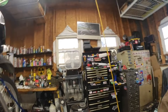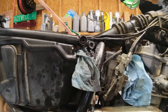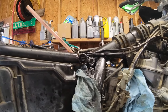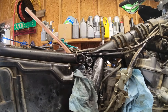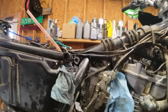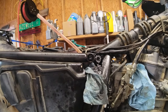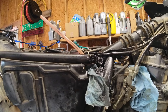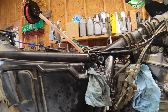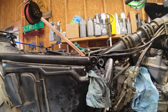Finally drilled through completely — I've been at it for hours. I didn't do any updates along the way because I was just too frustrated and wanted to get it done. After a lot of grinding and drilling, if you have a broken bolt, have extra drill bits on hand. I think it's a 5/16 and a 13/32 drill bit that Eagle Mike sends you. I've gone through quite a few drill bits to get through that broken bolt and through the frame where the bolt goes. Replace it before it breaks.